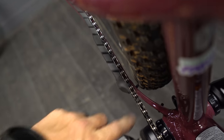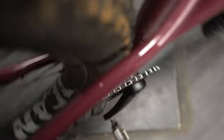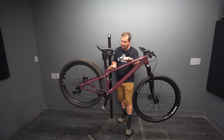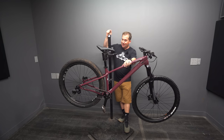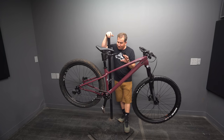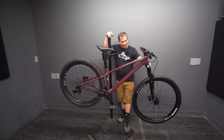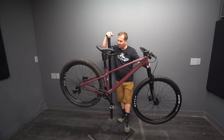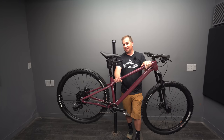We've got 6 mil clearance there, 5 mil clearance there, and even more clearance up top. Okay, I'm seriously impressed. I did not expect this to fit. I'd run this. This fits well enough to run. That could open this up to be a really cool bikepacker to have 29 by 3.0s on there, and I don't know if the Judy will fit it, a Pike will fit a 29 by 3.0 up front. Let's throw this on the geometer to see what the angles look like.